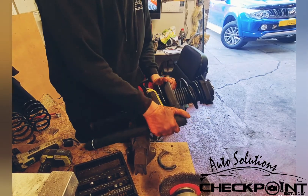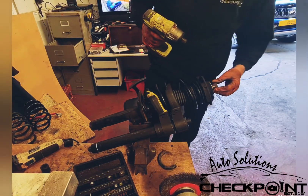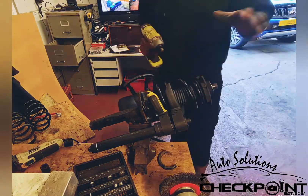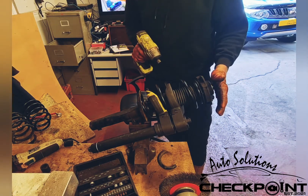So we're now loose. What we want to do is work at the top of this. Now this is off a Skoda Yeti, so it's a 21mm socket to the top of the strut.